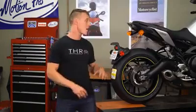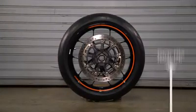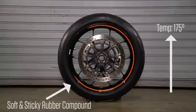It's arguably a topic for a separate video, but I can't talk about tire break-in and not talk about tire temperature. Tire grip is affected by texture, which is why we scrub in new tires, but temperature is an even more important ingredient in the grip equation, and it's a factor every time you ride. Those race tires I was talking about, they're ready to rip because they've been baking at 175 degrees on tire warmers and because they're made from super sticky rubber that's only meant to last for 20 laps.